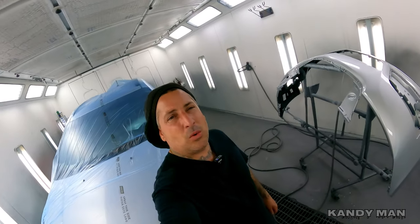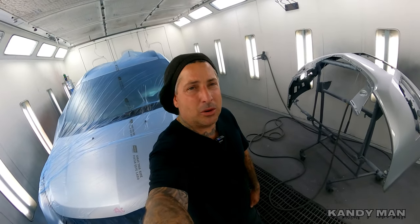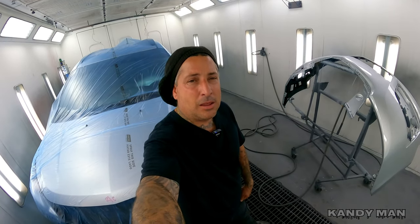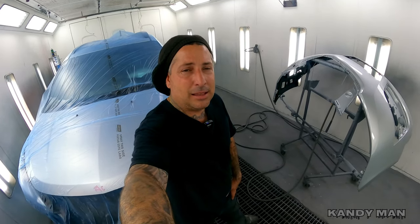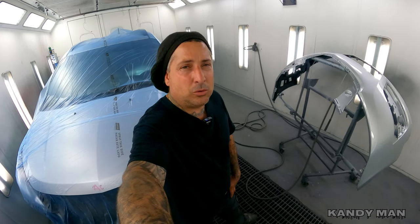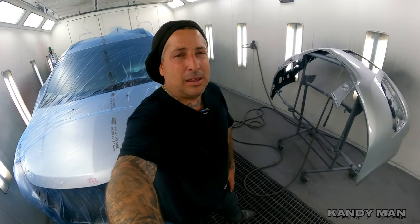That's the DV1 and it's been a minute since I've used it — it really is a phenomenal gun. I love the DV1 clear gun too, but this time I used my Tecna for clear coat because I've been using that gun a lot lately and it's been working out nicely. When I want to fine-tune a job I use the DV1 clear, and when I want to just blast one out and let the clear do the work I use the Tecna — it moves me through the job quicker.